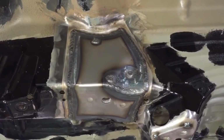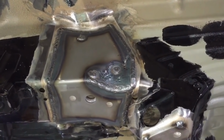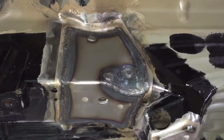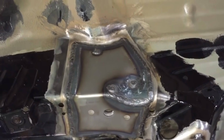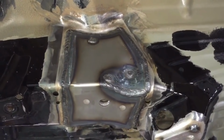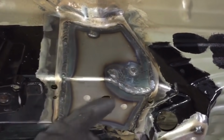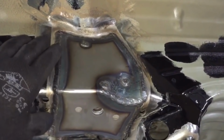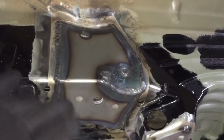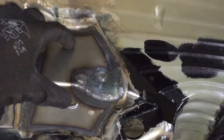So once we've welded our Redish Motorsport V2 reinforcement plates on, we've got an example here of the 4 stages of the secondary sort of repair which we do, which we think is fairly unique to us. We've been doing it for a few years, and we think others are missing a trick here, because carrying out the crack repair and using reinforcement plates is basically repairing the outside panel, but we want to make some additional connection to the internal threaded piece which is sat in there.